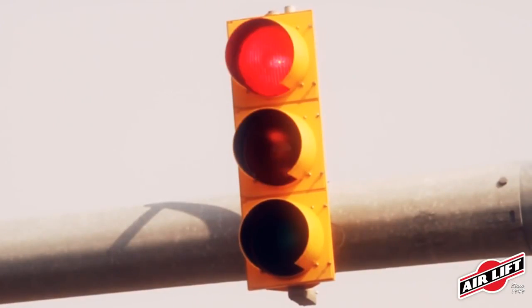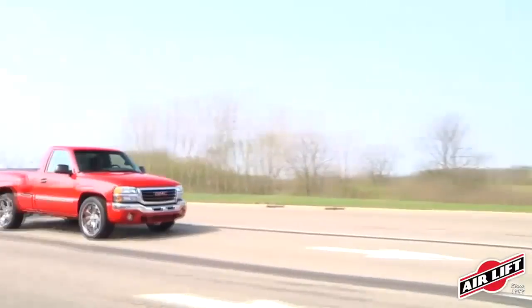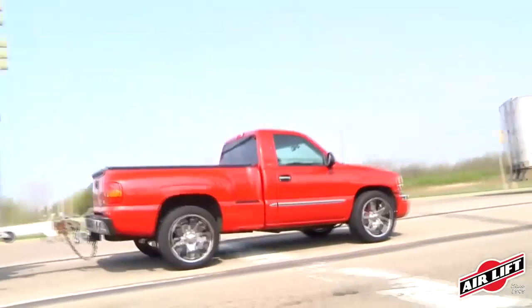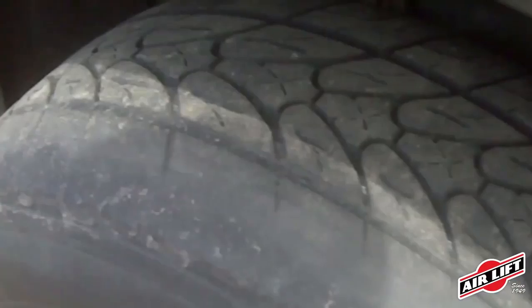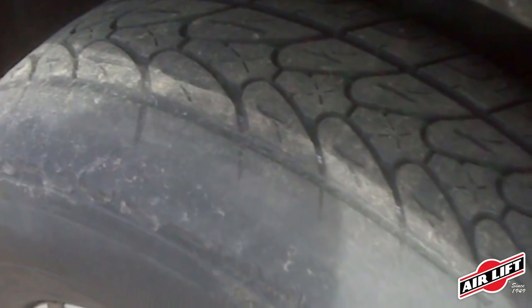You're also more likely to experience harsh jarring when going over bumpy roads or steep inclines. Your front tires do the majority of the braking and steering, so braking time is longer when all four tires are not firmly on the ground and steering gets light. Headlights also aim too high when the front end of the vehicle is not level, and tires don't wear evenly when weight is not evenly distributed.